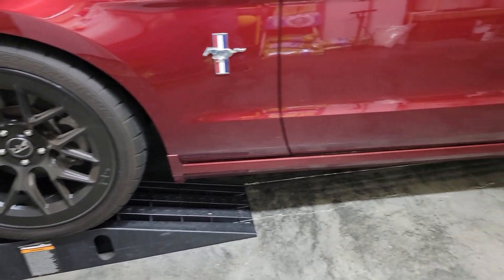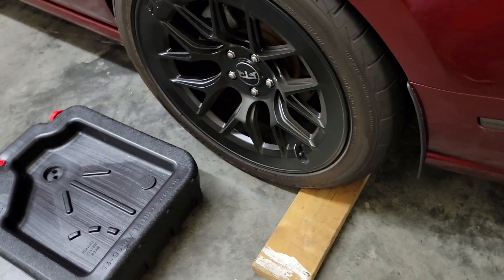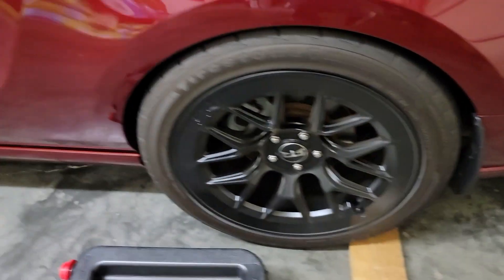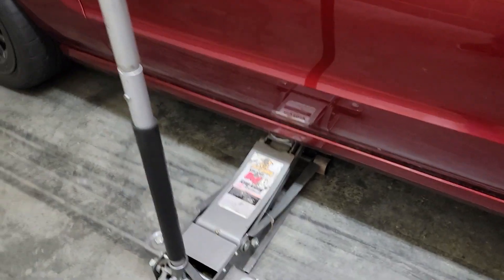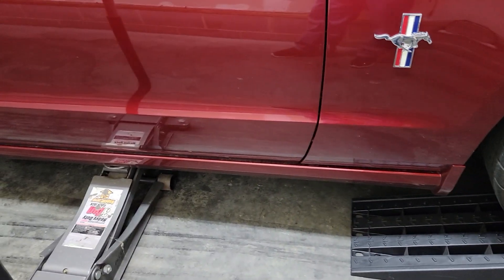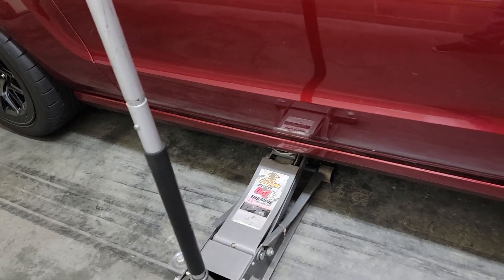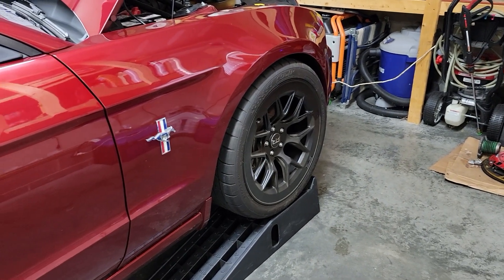Now you can see I got them on the stands, and what you also want to do just for safety is put a board on the back of your tire to make sure it doesn't accidentally roll out. It shouldn't — this is an automatic — but weirder things have happened, so I'd definitely do that for safety. I also leave the jack under the car jacked up just a little bit so just in case something happens — say a tire goes down while you're under the car — it picks it up. Or if you have spare rims and tires, shove them under there so they catch the fall.